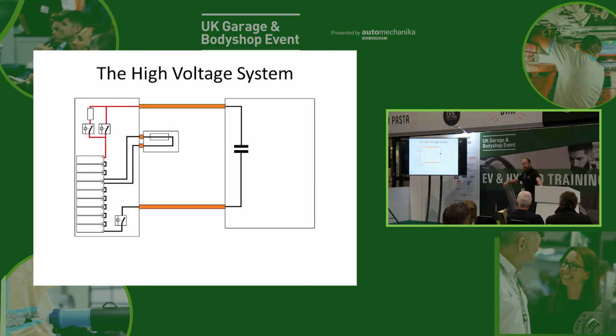Okay, now the AA have dumped that car outside the workshop. How do we get it in the workshop? Well, the car can actually only do this test when you turn it off. So if you clear the code, the car doesn't actually know that the problem's still there. You'll find that the car now thinks there's nothing wrong with it because it's thinking, well, I've got 0 volts this side, I've got high voltage in the battery, everything looks okay, I'll start the car up. So it'll turn all the contactors on in the right sequence, the car will start up, no fault codes, you can drive it about, no problem whatsoever. And then as soon as you turn the car back off again, it's going to run through that same test and it will say, hang on a minute, you've got a contactor fault here. So that's how we get our contactor check.